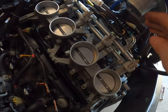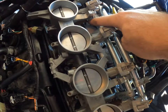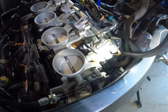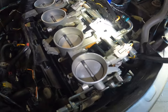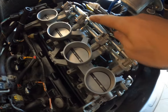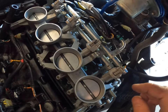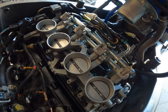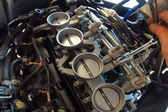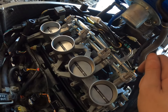I've got everything back together. All the fuel injectors were cleaned — the top ones as well as all the bottom ones, which are brown injectors. There are four of those. The fuel rail was all removed, and I also replaced the bolts on top with hex bolts. The reason is they're way easier to get off — you can use a socket set, like this 10 millimeter, and actually turn them.